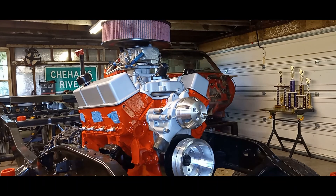The heads being ported weren't the only reason this thing makes the power that it does. The chambers have been reworked, the valves have been unshrouded, the cylinder walls were actually unshrouded. It has a 12.96-to-1 compression ratio, and that takes 110 octane. The rockers are 1.6, so that effectively makes lift about 650 thousandths. The cam specs are 620 lift, 248 degrees duration at 50 thousandths, on a 108-degree lobe separation angle with a 104-degree intake centerline. It's a solid roller. The valvetrain's been set up to prevent valve float running at higher RPM than the cam was intended to. The whole reason I set up a bog/drag engine like this is when you're doing a thousand RPM beyond peak power — you get more tire speed, and if the engine does start loading up, you fall back into peak power and it's less likely to bog the engine down.